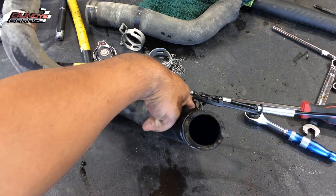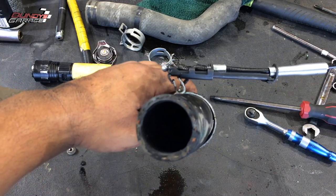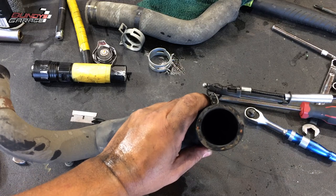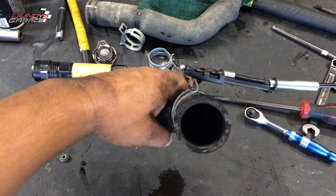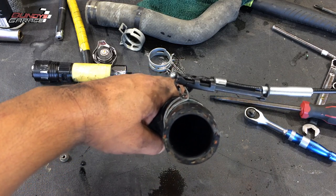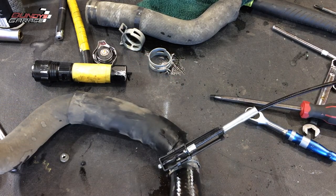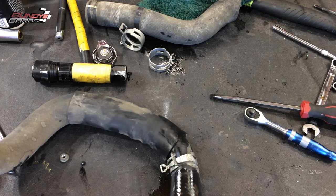Okay, that one worked because I had to bend it — you can actually see it right there, the tab is bending down. The only reason it's bending is because I had to use a crescent wrench adjusted to get the thing to collapse and get it off, because it was on the very bottom lower hose up against the radiator. So I hate those things — I hate those tabs. A lot of clamps don't even have that, but a lot of manufacturers think it makes good sense because it'll make it easier for the mechanics. It doesn't.